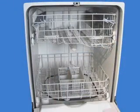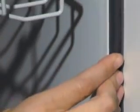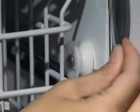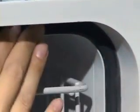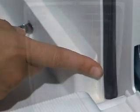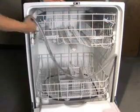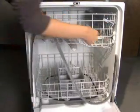For plastic tub dishwashers with a wide black gasket, check along the gasket to ensure it is fully seated in all locations, especially where leakage has occurred. Anywhere it is not fully seated, simply press it in with your fingertips. Check the corners to ensure that they are not kinked and check the tails to see that they are properly aligned. To reseat the gasket, pull out the gasket and find the line located on the back in the center.